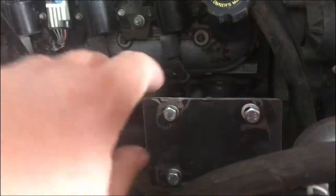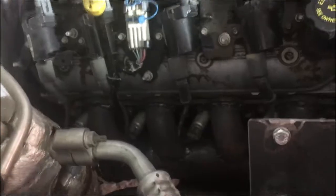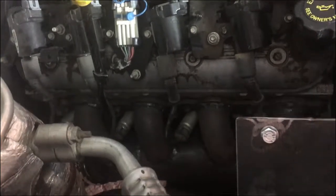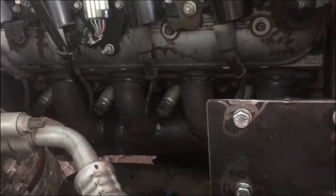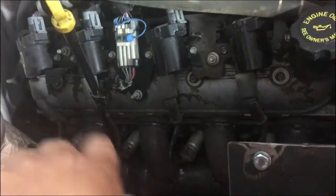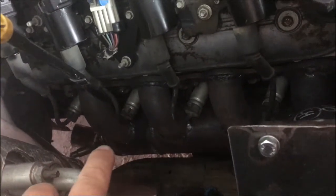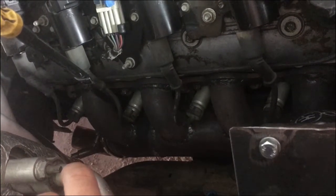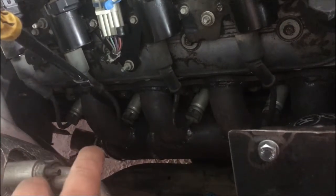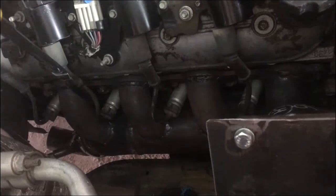I've got my manifold finished and installed, and I've just been driving it around for a few days. I just made a block-off plate here where the turbo is going to go. Manifold is done and installed there. Right now it's just exiting out the normal way a manifold would exit on a non-turbo truck — I've just got the factory part of the exhaust V-banded onto the manifold there, and now I'm going to finish up that crossover pipe underneath and get closer to having the turbo actually bolted on.